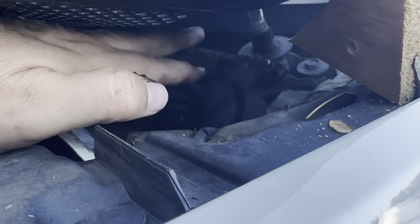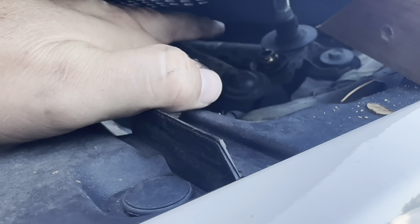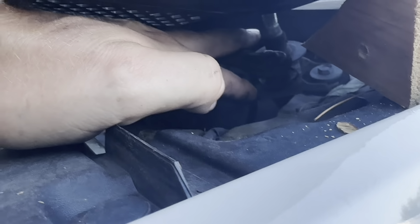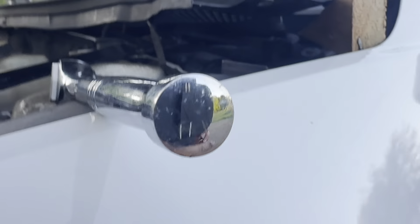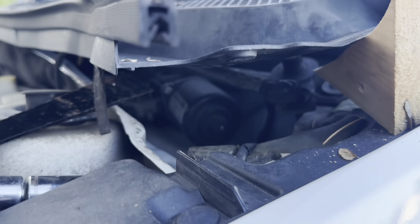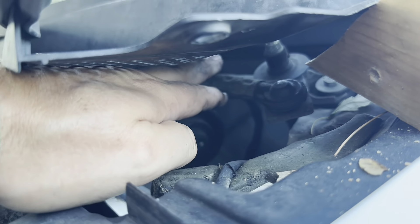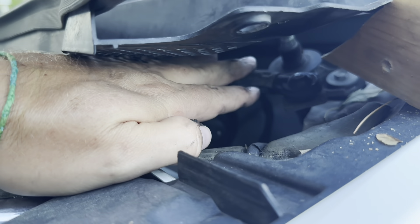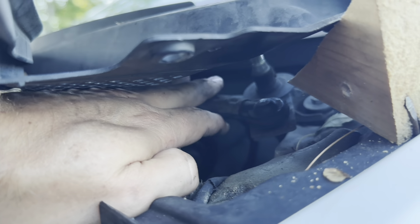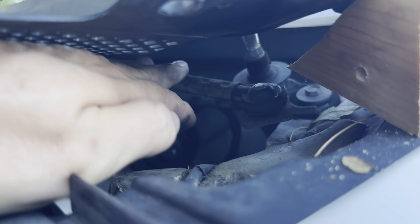Hopefully you can see this — right here is my issue. There's this piece which when it turns, it turns the windshield wiper. This is the arm that goes on there. This arm piece was off of it — it goes right in there. It should be all lined up and stay on, but it's popping off, which means something is probably broken inside. First thing I'm going to do is grab some pliers and see if there's something that just popped out. Let me get those and give that a shot.